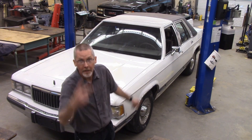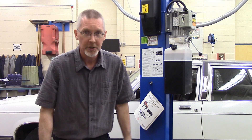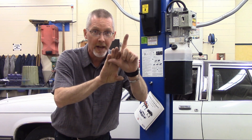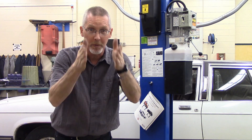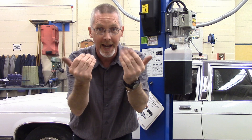Today, we're going to put a vehicle on the two-post hoist. You may want to enlist the help of a lackey to get your vehicle between the two posts equally. If you're too far to one side, these arms aren't going to be able to reach and pick up your vehicle. You want it as centered as possible. Having somebody up front guiding you is probably a good idea. One of the significant things you want to get right is the weight distribution.